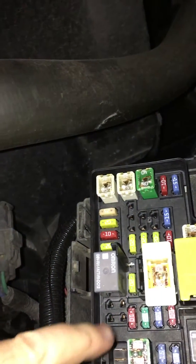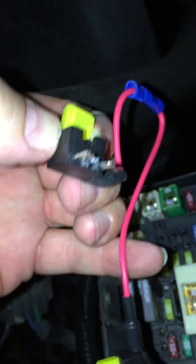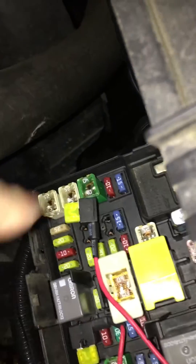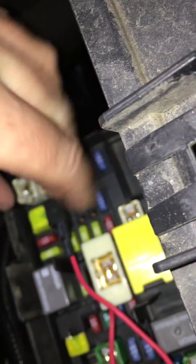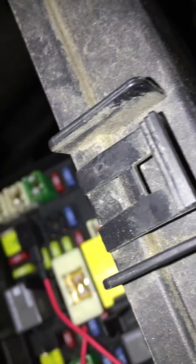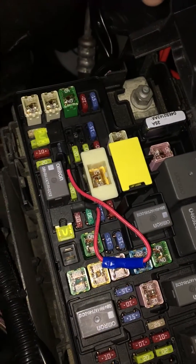This one here — that is the fuel pump. So there's a little contraption I made to get me going, just to bypass it. Because the relay isn't getting any power up here when I go to put the key in the run position. What this does is the cigarette lighter actually runs off the ignition circuit, so when you start it, it gets power to the fuel pump and the truck runs. This isn't ideal, but it beats having a five-thousand-pound doorstop on the side of the road.